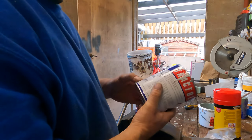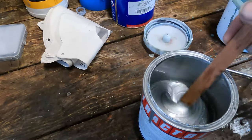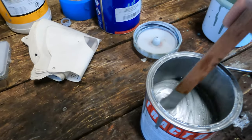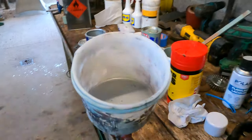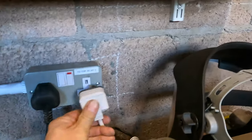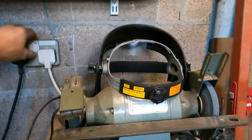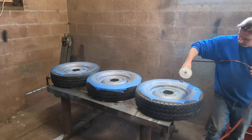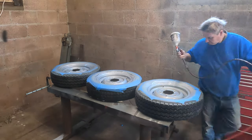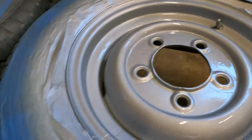This is the paint we're using — Case International Silver. It's already got some thinners in it, so I might be able to go straight in the gun. To me, it's a little bit too thick, so we'll just put a tiny bit of thinners in it. That should be enough. I've got a fan in the window, compressor on, and off we go. I've only got a little compressor this time, but it works. You can see — it does shine, pretty good.